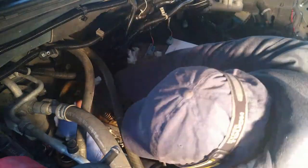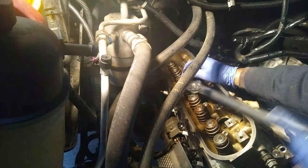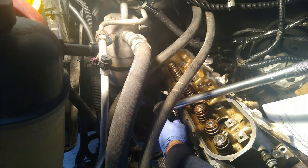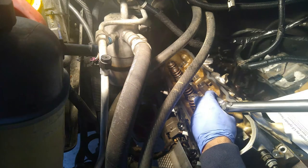Right now I'm finger tightening the bolts. The one in the back I can't reach with my fingers, so I'm using a little wrench there to get it somewhat tightened down. Okay, so now we're getting started. The number one bolt in the center. Number two drops straight down. Looks like I got place my paper upside down, whoops. And so number three, I should be coming to the front, but instead, or I'm sorry, I should be going to the back, but instead I come to the front, which with the paper upside down means number four is more towards the back now.